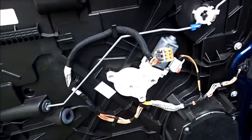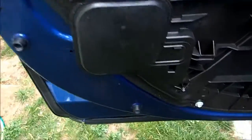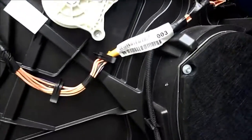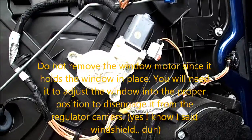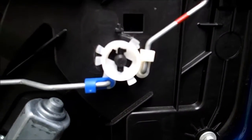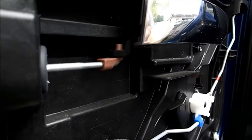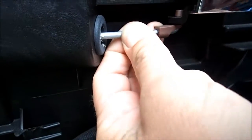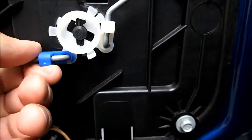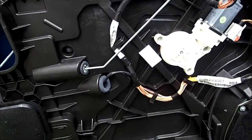The next thing we want to do is disassemble all the hardware on this inner door panel so we can remove it and see what's going on inside. It's flanked with these 10mm head bolts. There's a speaker that, judging by the harness, I'm going to have to remove. I'm also going to have to remove the window motor, and this little lock drum that connects the linkages for the lock, as well as the handle — it's going to have to be disconnected. These actually remove pretty easy — you just have to snap them out like this and they come right out.